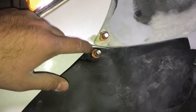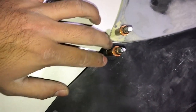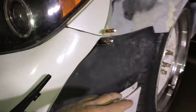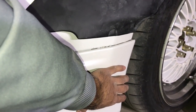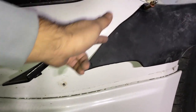I got the bumper cover completely trimmed down. There's just a small little space but we're going to fill that in with fiberglass — I wanted this piece right here to fit as close as possible to where the other cleco pin is going to go. We'll fill that little gap with fiberglass and make it all smooth. Right here it looks perfectly aligned all the way down. Over here we're going to have to pick it up a little bit, but we still need to do the same thing we did underneath — push it out a bit. On the bottom I'm going to cut it here all the way down and extend this part all the way down to where the RS3 bumper lip fits, covering all of that up so it's pointing all the way down.